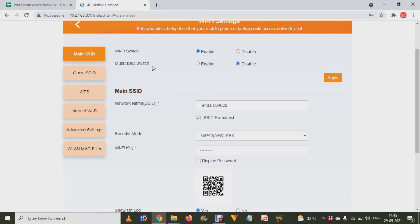Now you can check out the main options here. From these options, you have to find the SSID Broadcast setting and untick that checkbox. After that, change the Wi-Fi name according to your choice, because when it becomes a private network, you will have to manually connect to this Wi-Fi hotspot using that name.